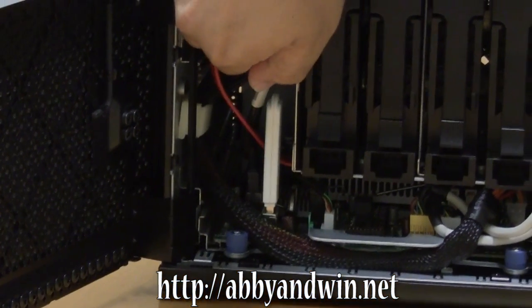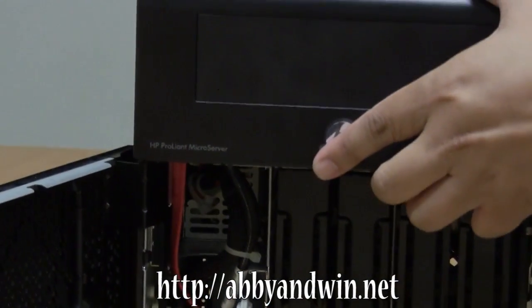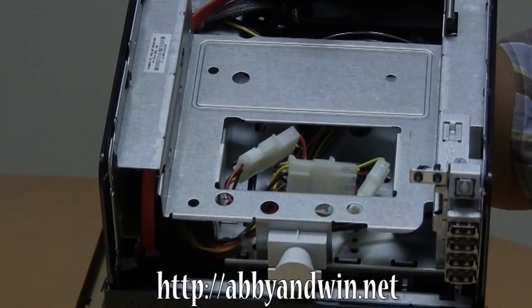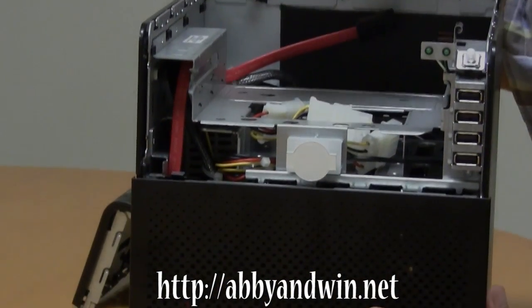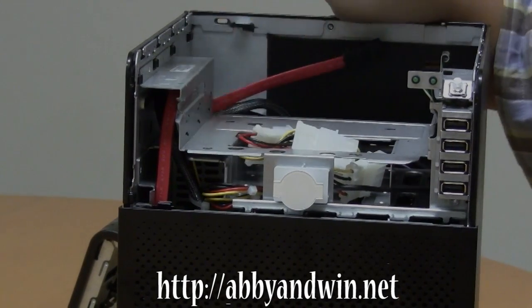Other modifications I've already made: I put in a 1 gig USB flash drive — this is where my ESXi is installed. I've added another SATA cable and ran it to the top. If you need a DVD-ROM, it'll sit up top here, or you can just throw in a fifth hard drive up here — 3.5 or 2.5, doesn't really matter.